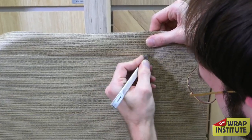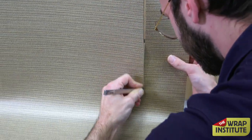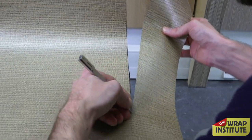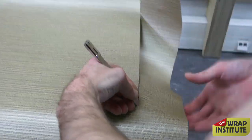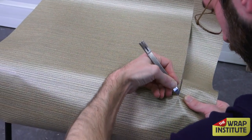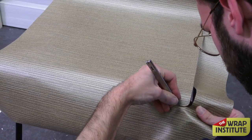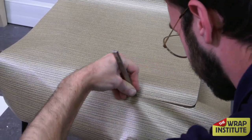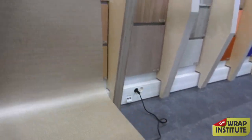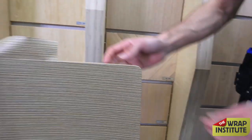This chair is actually tricky for finishing. He's showing the traditional style — angling the blade in — and for the most part it cuts well, but interior film, especially a textured one, can be tricky to cut with a blade. These chair edges aren't 100% uniform and straight, so the blade naturally chatters. That's not a bad cut — it just means the edge is rough, causing the material to hang out and get picked up easily.